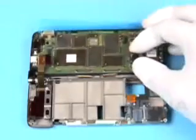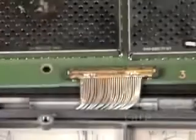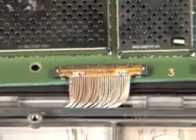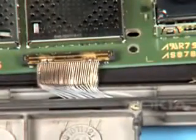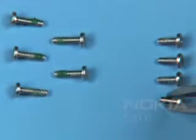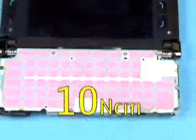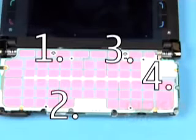Place the engine module over the protected display of the upper part. Close the flex foil connector. Be double accurate while closing these two micro coax harness connectors. Check the correct placement of the cables before going on. Take these four screws and place them into their recesses. Set the correct torque. Apply the torque to these screws in the order shown.